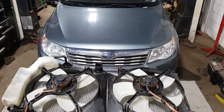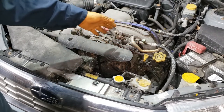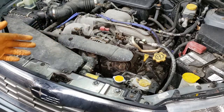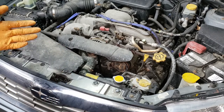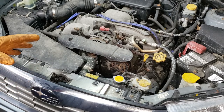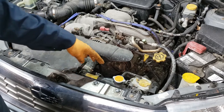Our first step is going to be to open the hood. As you can see we have some sprayage happening in this vicinity because we have a leak and an overheating situation spraying coolant onto the engine. There was a small crack so it has been seeping for a while. This whole situation could have been avoided if the customer had the time and funds to repair it earlier. Whenever you see a potential leak or this sort of crusting, you've got to deal with these things sooner rather than later.